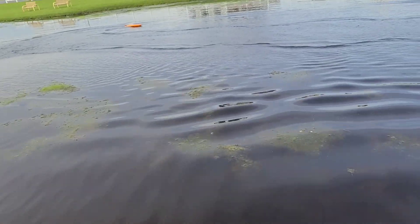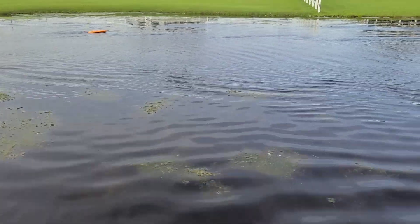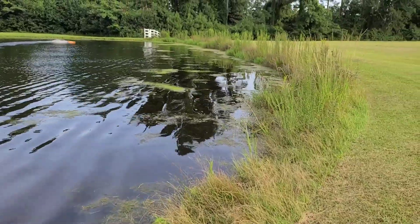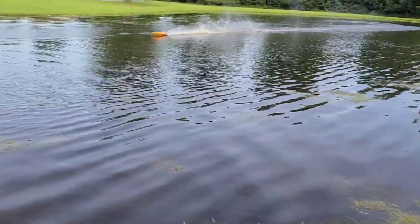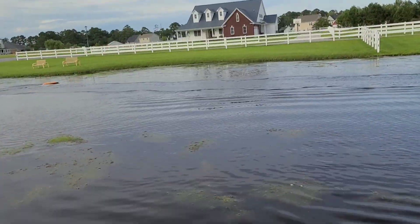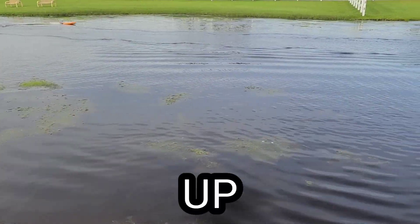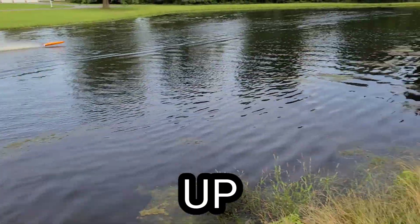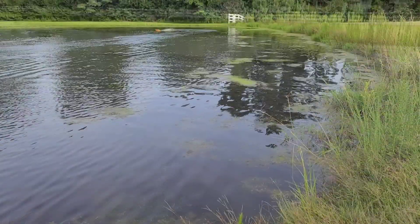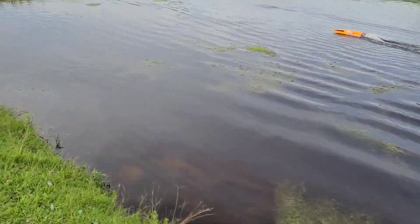So that's actually good and bad. You don't want your boat all the way out of the water because you won't have any control. But you want it up out of the water to get speed. See how she's wanting to fly — almost wanting to actually flip over. So that's the difference between trim tabs all the way down running wet and all the way up running dry.